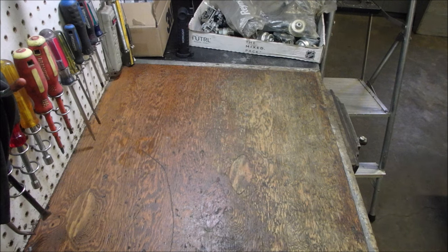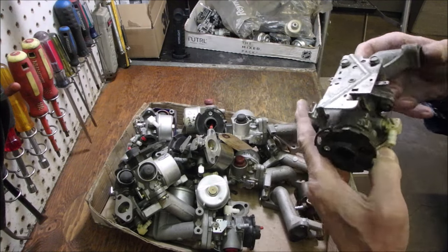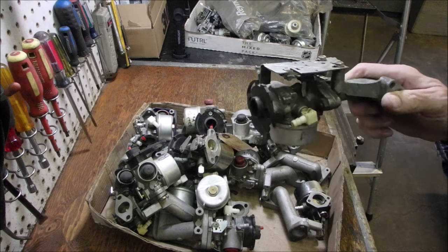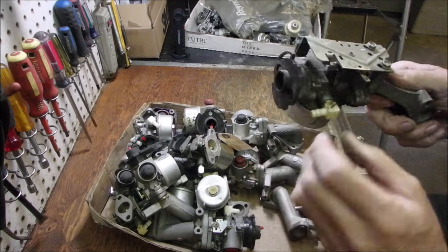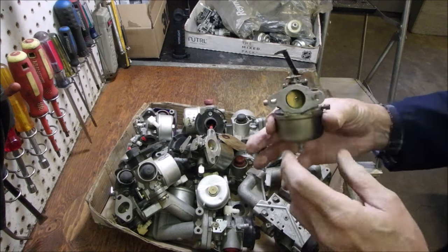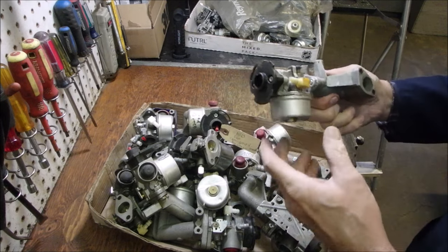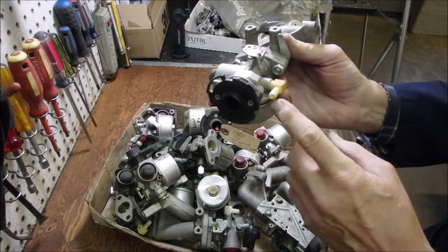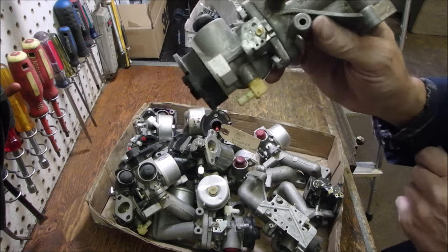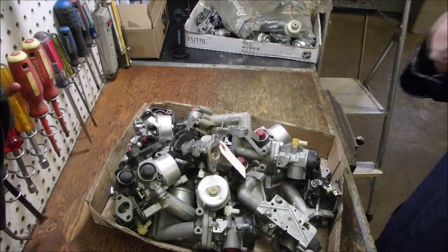This is just Honda parts: bowls, emulsion tubes, Honda levers and springs. I have that with each manufacturer actually. There's also a Tecumseh carburetor from an older style Tecumseh with a throttle on the side — that's a five horse horizontal because there's no 90-degree elbow on the fuel intake. There's a Tecumseh with a 90-degree throttle intake — you know that's come off of a vertical Tecumseh. Some are labeled 'not tested,' and I try to put a little information on them if I can.